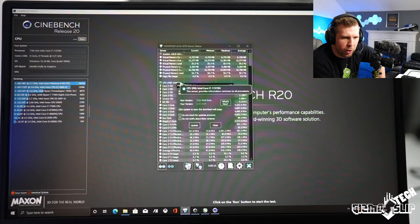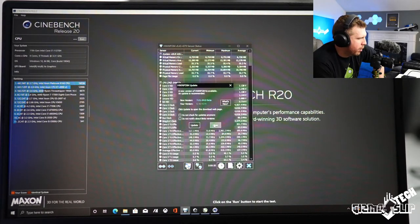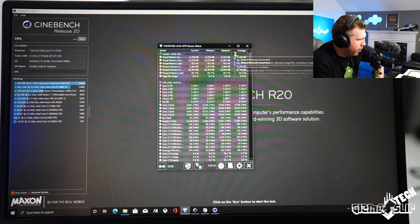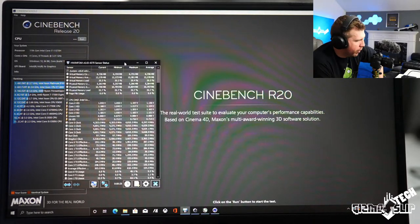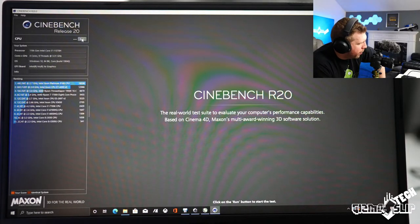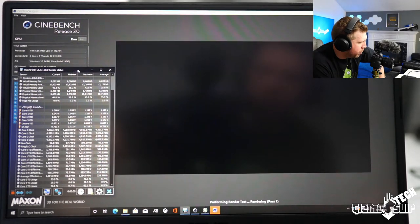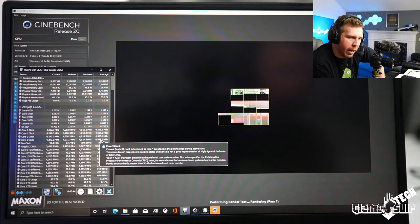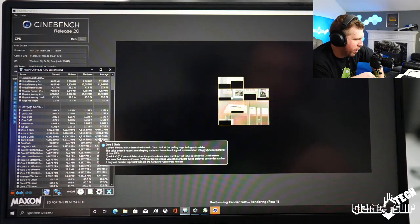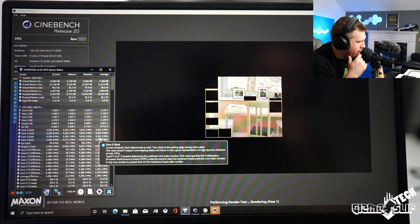Gato Paint: for laptops, should I go Intel or AMD Ryzen? My recommendation for most people is going to be the Ryzen 5000 series, but it just depends. It depends on what you're going to do, right? If you're just mainly going to be gaming, doing some productivity tasks, it doesn't matter that much between the two, because gaming performance is very similar. But Ryzen is just better thermally speaking, because it's a 7-nanometer chip versus 14-nanometer. And this is a 10-nanometer chip. This is the 11th gen Intel, but it's only 4 cores. So we're going to see how this does in Cinebench R20.